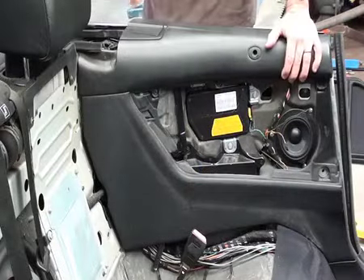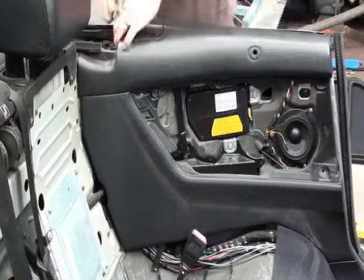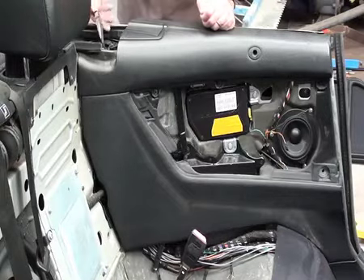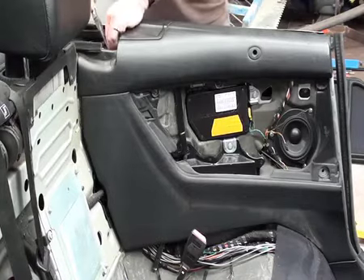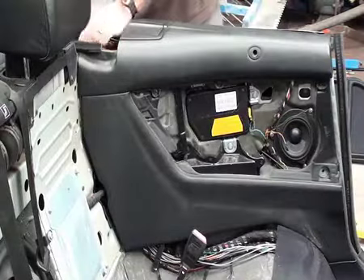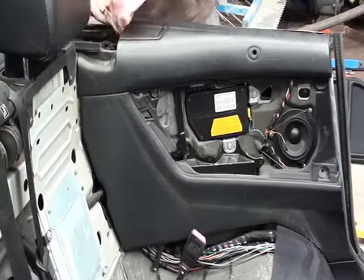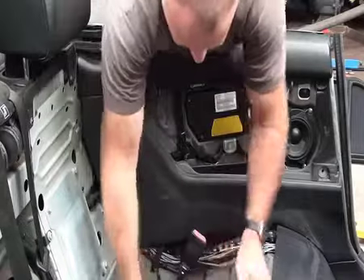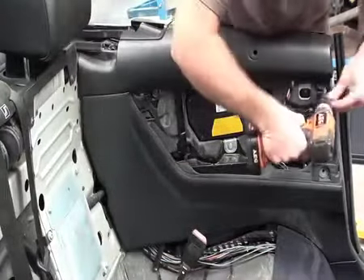To remove this panel, the first thing I'm going to do is raise the compartment lid and hold it up, then come in here and remove this piece here which is the spring. Depending on the year of your car — they changed it in the later models — this is a 2001 car so it's one of the original designs. I'm going to get some pliers and remove that spring from where it holds. First I'll pull out the plastic piece, then pull the spring out, disconnect that down here, and once that's out, I'm going to use a 7mm — there are three screws along the top here to remove.